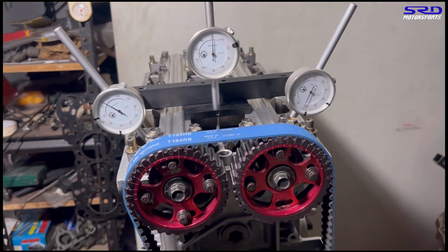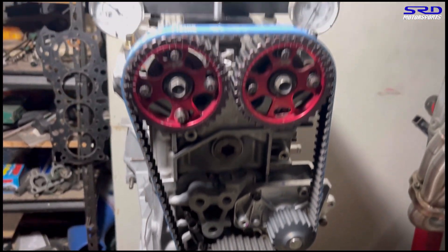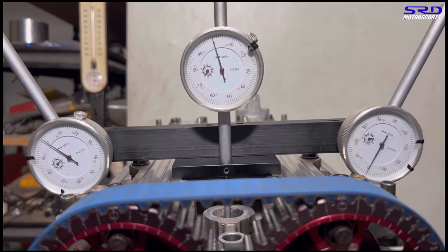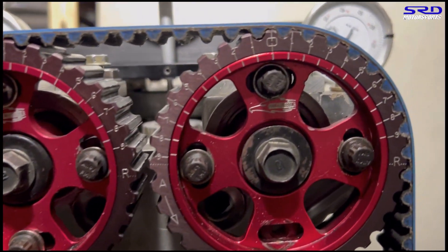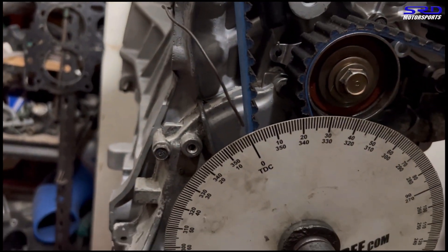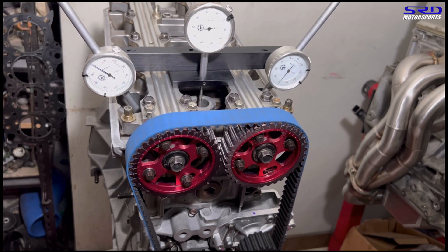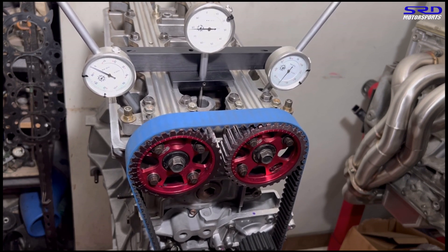Now let's degree the cams — this is what you guys are here for. We're all set up with the degree kit, originally made by Mike Belbin, so props to that old-school guy. Let's get this to top dead center. Make sure it's accurate. With the intake at zero degrees and the exhaust at plus four — that's where we clay-tested — we start the valve-to-valve check and proceed to measuring the exhaust. I need a favor from you guys: write down the numbers so we can do this all together.